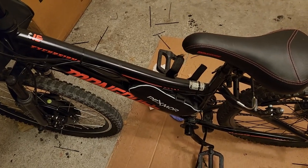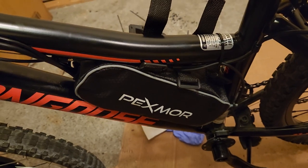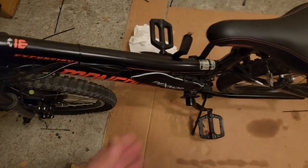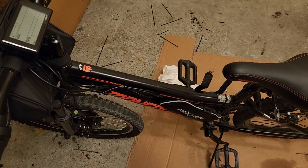That's pretty much everything wired up. I zip tied all the wires in place and kept it as clean looking as possible. The motor wires are zip tied going along the fork this way. I was able to get the controller bag in between the frame — it wasn't easy, but it fits. The bag only contains the controller because that's all there's room for. I'll need a different bag for the battery to mount up on the frame — just two wires come out of the bag and plug into the battery.